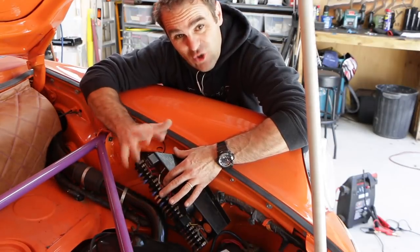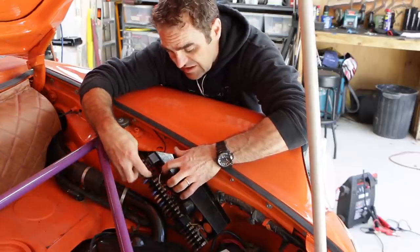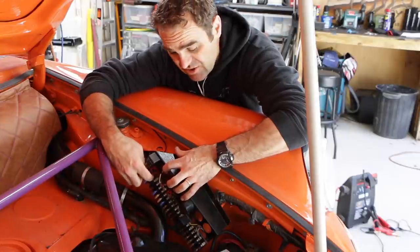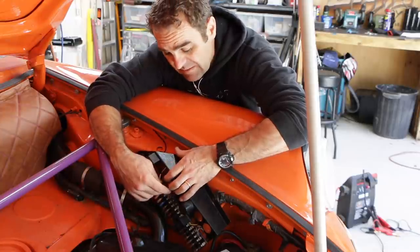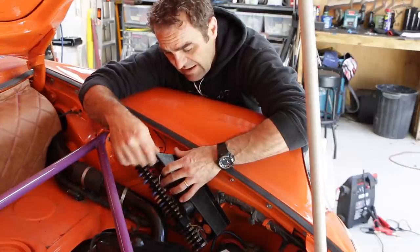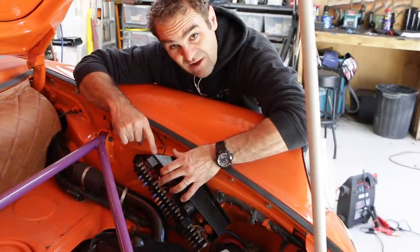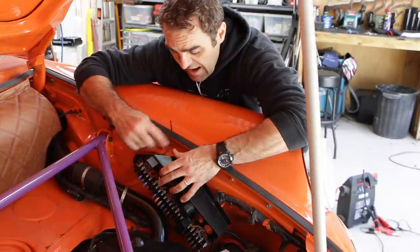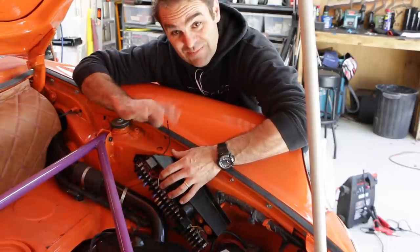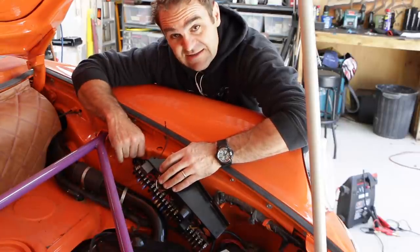Using this fuse box makes it quite easy to set up the relay and the whole fuel pump setup. Some panel sections have full-time power straight from the battery, and this area here is from the key — from the ignition. So I've got my ignition source and my permanent source from the battery. The ECU has a switched ground, and that's how the fuel pump switches on. Now I'm just going to send my power down underneath the car to the fuel pump. It's probably confusing, but trust me it should all be sorted — nice and neat and tidy. Let's get underneath now and wire up a fuel pump.